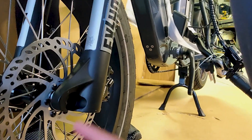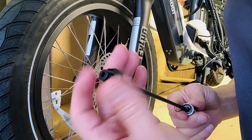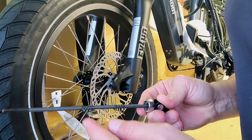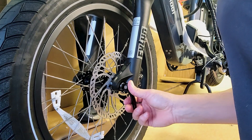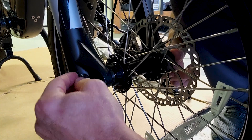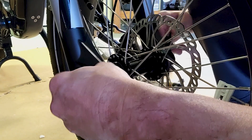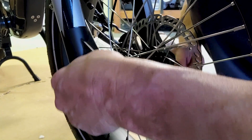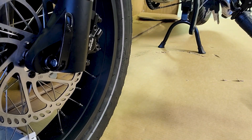Once you do that, put the rotor through the brake pad and slowly lower it down onto each fork. Then take your front bolt — this is your front axle — pull off the little end cap and you have two springs. You want the outside to be the wide end of the spring. Don't lose them. One end goes through here, put your spring on with the wide side on the outside, then the cap. Get it finger tight, and once you have the lever, tighten it up. That puts the front wheel on. Pretty easy. The bike will stand up by itself — it's got a center kickstand, kind of like a moped.